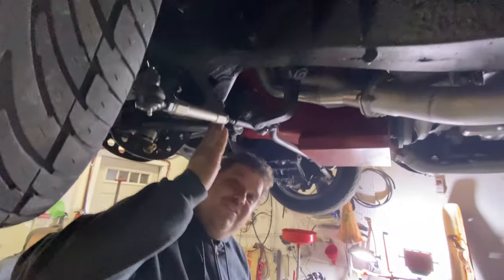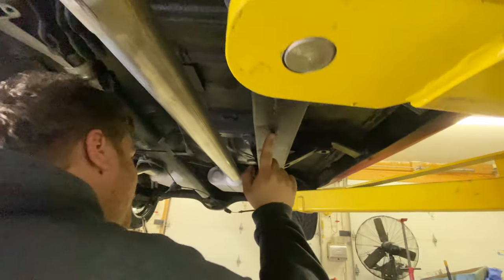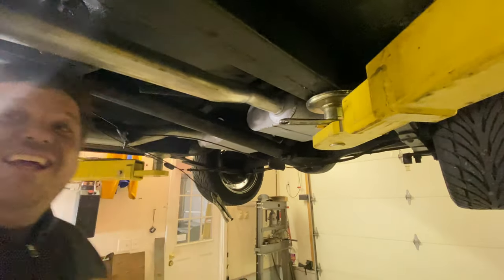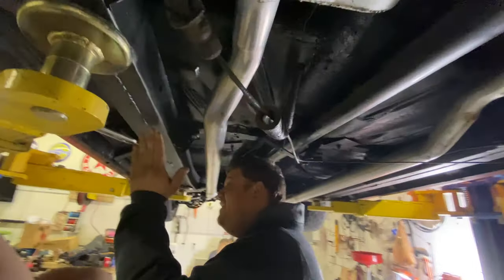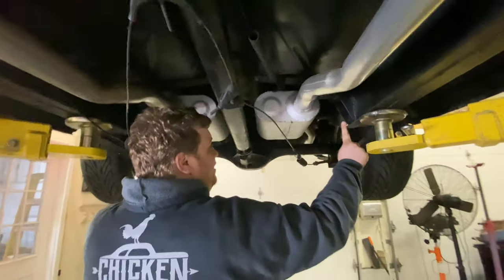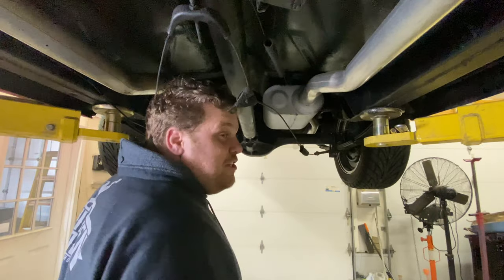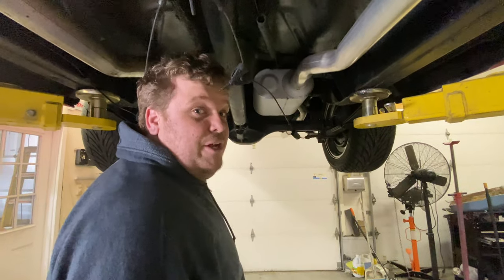So if you follow down the length of the frame, just follow me here, all the way down. You notice this weld, the whole length of the car? That's a two-piece frame. If it was a one-piece frame, this weld, follow this way, down the length of the car, would not exist. But it does. However, this comes into play with your cross member that mounts from here to here. This is 35 and an eighth, a quarter, somewhere in there. Our cross member is 33 and a half. Doesn't fit. Now you know.